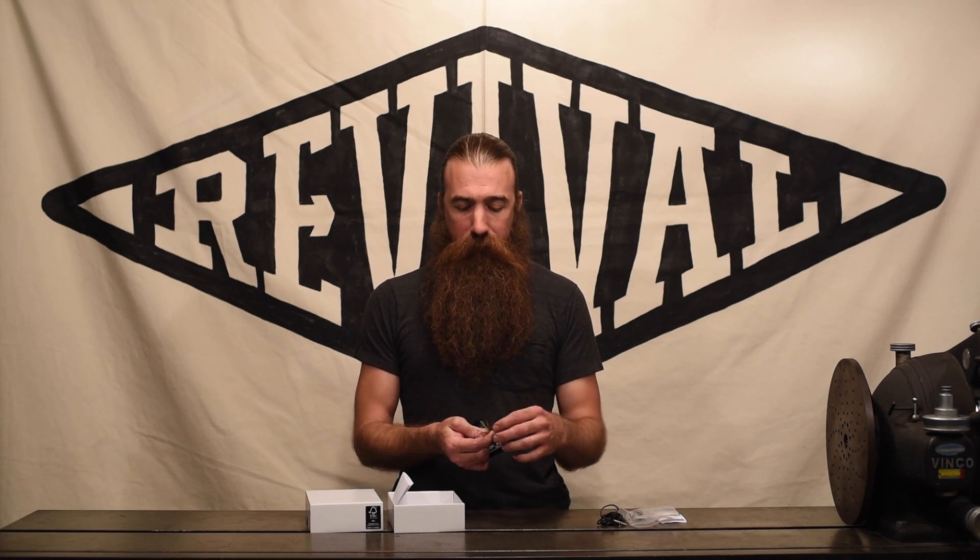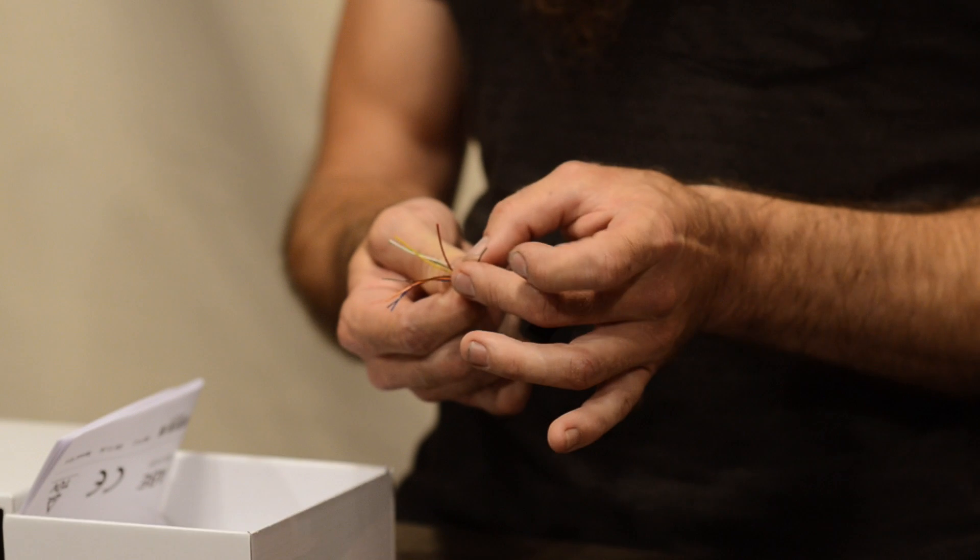That's the overview of what's in the box. Now let's get into what all these wires actually do. The black wire is ground. The red wire is constant voltage — constant plus 12V power — so you don't lose memory in the instrument. It keeps a time-of-day clock and total lifetime hours. You can even configure this gauge to track service limits, like changing your oil every 100 hours or 3,000 miles.